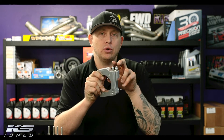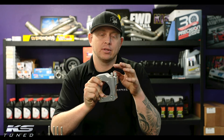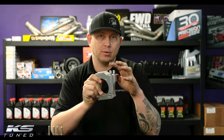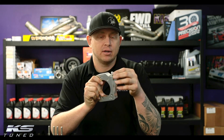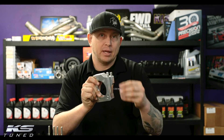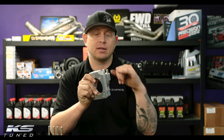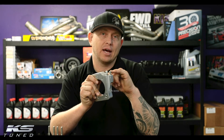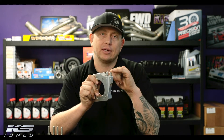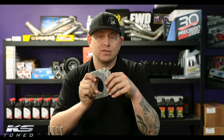It comes with two injection ports that are capped off — caps are included. So if you're only using a single dry shot, you can just leave the cap on the other fitting and you're good to go. All you need to do to add nitrous or replace a nozzle is remove the cap, insert the jet, and this accepts all standard nitrous jets — anything from Nitrous Outlet, NOS, Nitrous Express — any of those standard nitrous jets will fit this fitting.